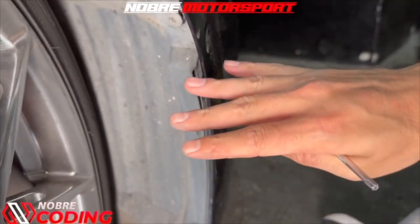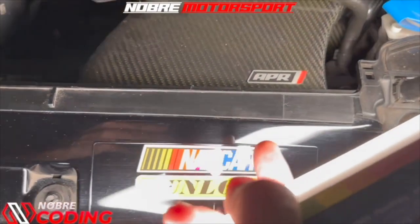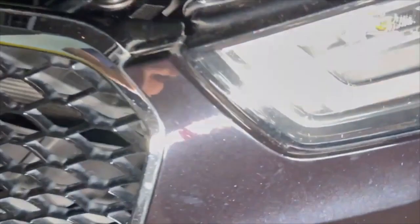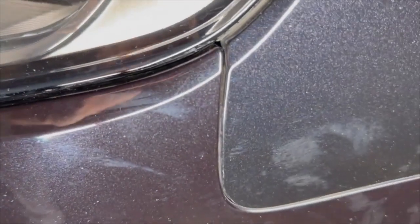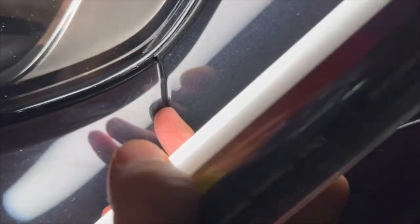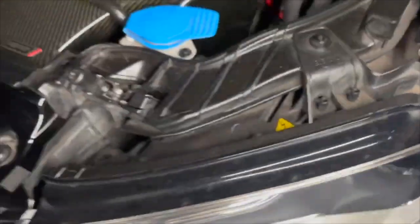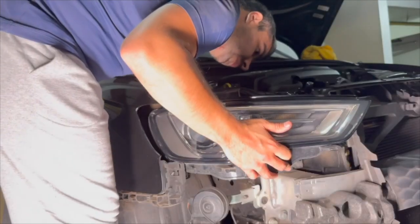The final result after assembly: you have to press it very well. The three screws at the top of the grill are finalized. Around the headlight it's a perfect fit — the side should have no gaps or creases. As you can see, it fits super well — there isn't even space to put a fingernail. To summarize: there are the three top screws, the screw from bottom to top on the edge, and the screws located under the bumper.